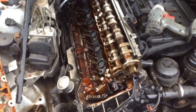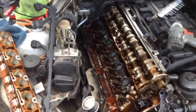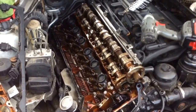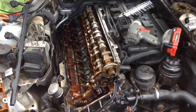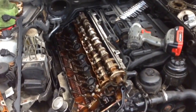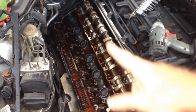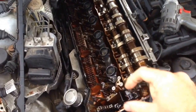I don't know if that's really worth it. We have the ability to just take the cams out and retime that engine. I don't know what's going to be faster. It kind of works out to where the timing tool kit's only like $160, and the valve seals are $40. The kit bolts on the studs, and the way it's set up on the N62, you could have a lever, and it pushes down these little cups. You can slide the lifter out.